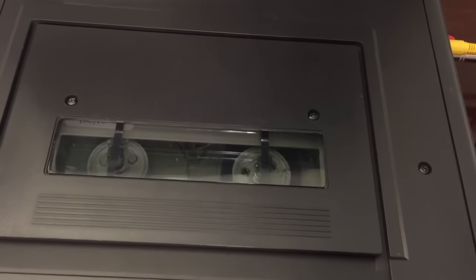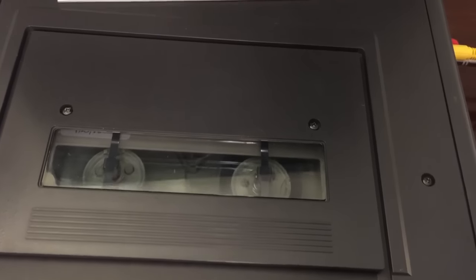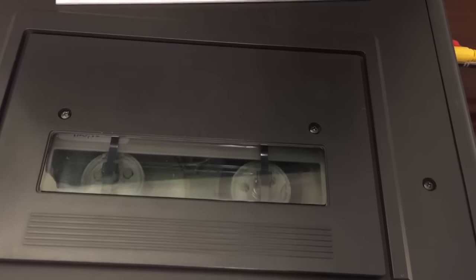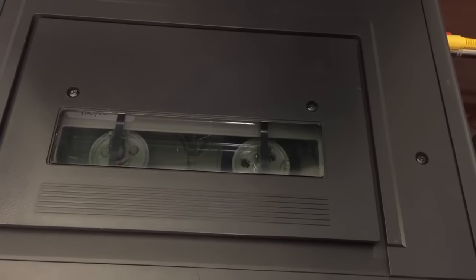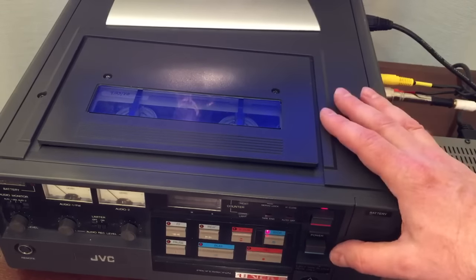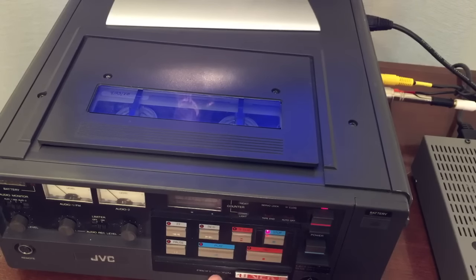Let's see what the quality looks like. The quality is like broadcast quality — DVD or Laserdisc quality analog video. I'd guess it has around 500 lines of resolution or more. However, even though I only paid $15 for this unit plus $15 for the power supply, it has a problem with the video head — it probably needs new video heads because these machines had many hours of recording and heads would wear out. When I try to record, I get a beeping sound and an H-clog light. So we'll just look at a pre-recorded tape.